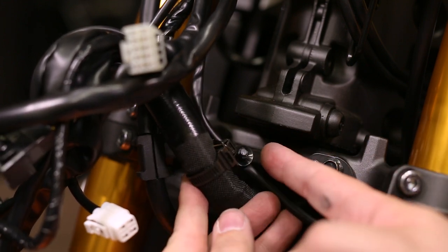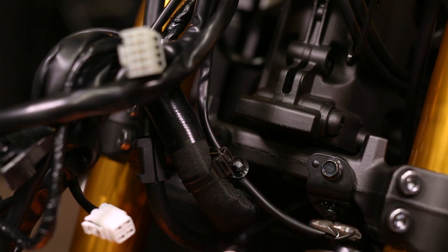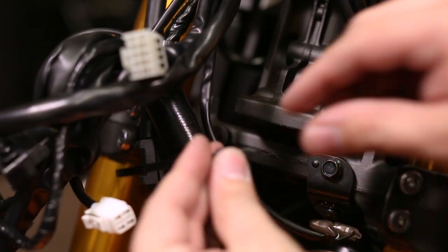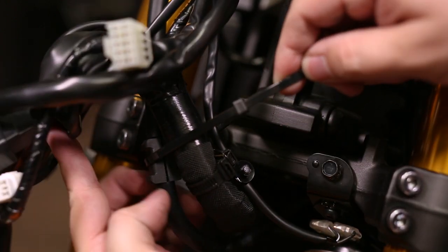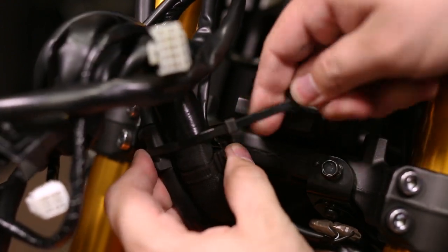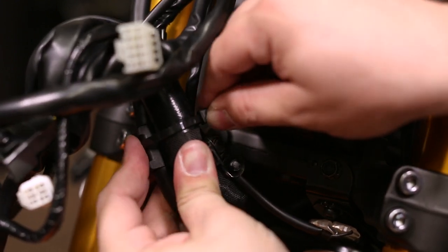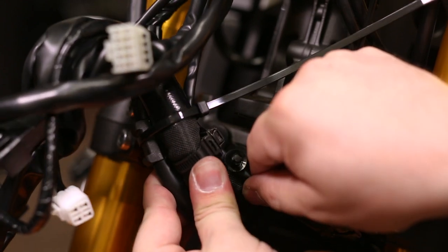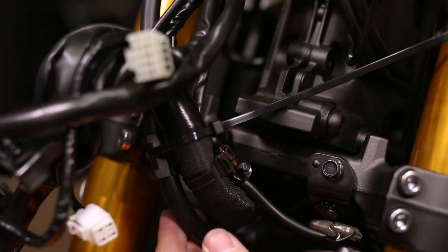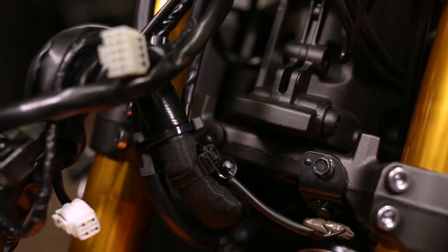It's up to you if you want to remove the wiring clip holders with your cutters. We're going to leave those in case we ever want to put the stock headlight back on. Using the supplied zip tie, go around the grommet on the brake line, the wiring harness, and the horn line. This doesn't need to be super tight, just snug so that there is some play in the lines. Everything moves as one on the steering, so it shouldn't be a problem. Trim the excess and make sure there's no binding.